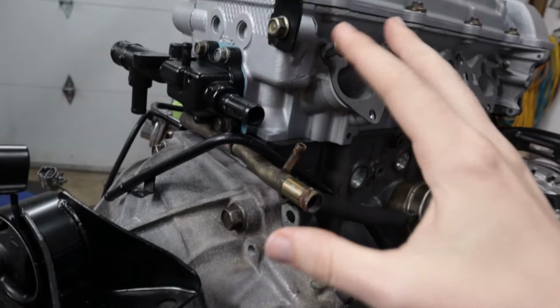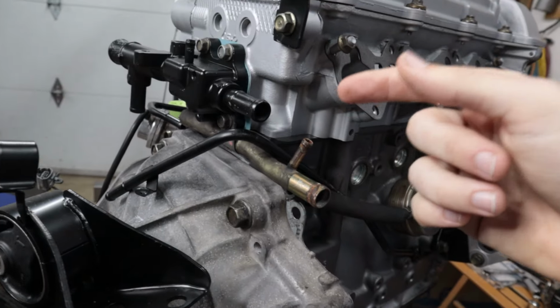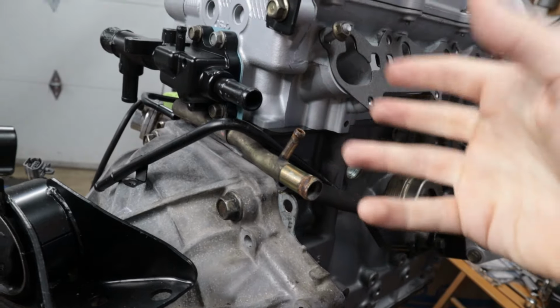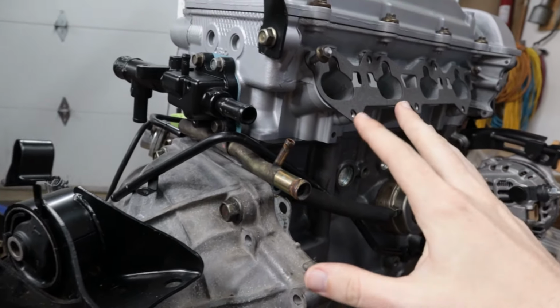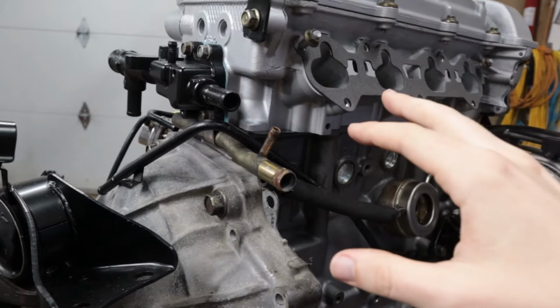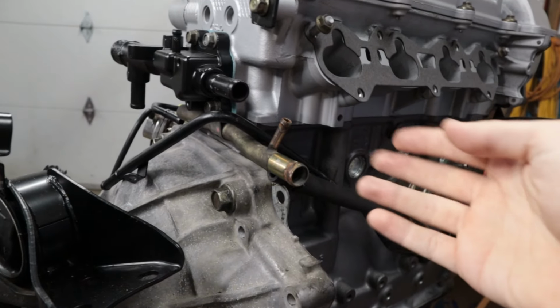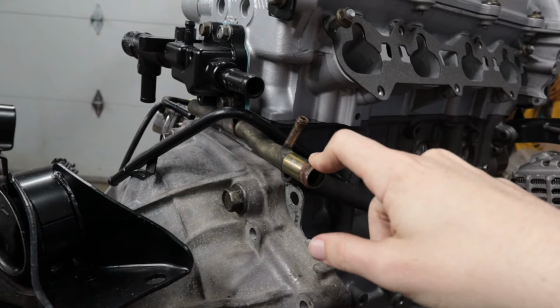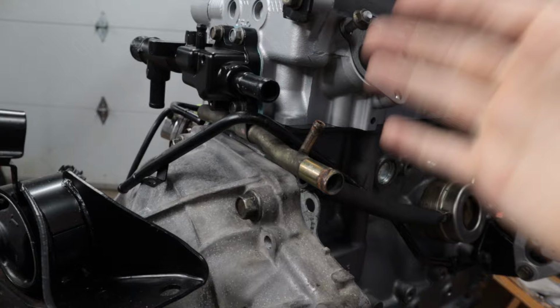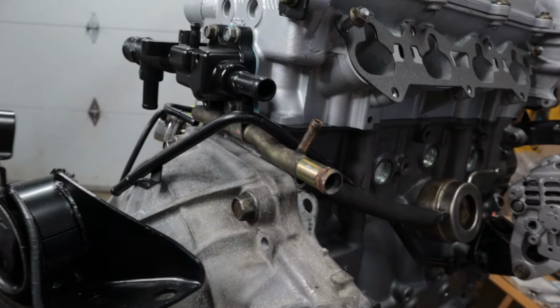and then just not run the coolant circulation for the throttle body. For those that don't know, the throttle body coolant line is designed such that in really cold climates, the throttle body won't lock up or freeze. I don't think it's really an issue where I live, but I have heard that the car might have trouble starting in cold weather, and we have cold weather coming up very soon. So I didn't really want to compromise it. The car would probably be okay, but since I want to daily drive this vehicle, I really want to maintain as many factory systems as possible.